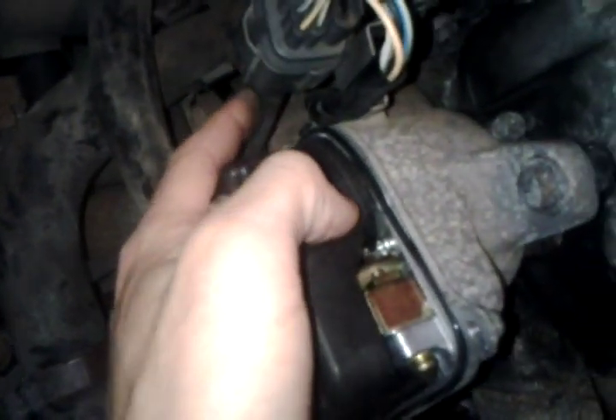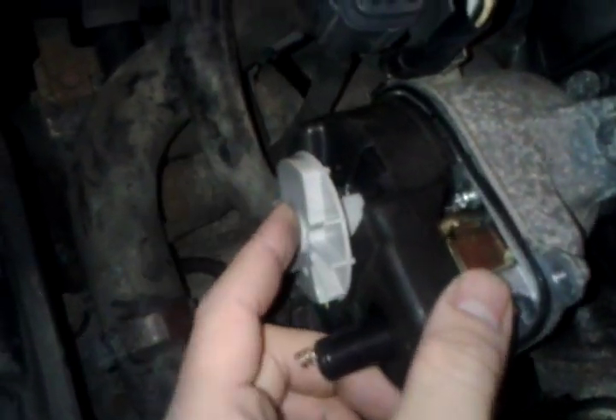So, this is a pretty easy change. You've got three bolts here on the cap — one, two, three, comes off. The rotor is held on with a screw right back there, then this pulls off and this cover pulls off. Then you have the coil exposed — you've got one screw here, one screw down here, and two Phillips head screws also on the test points. Then that comes out, slide the new one back in and just reverse the process.